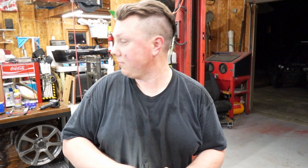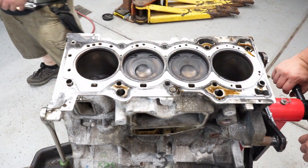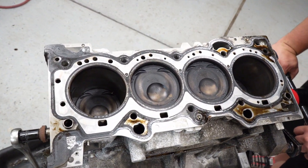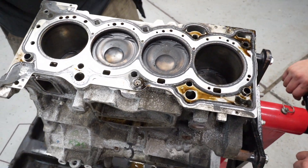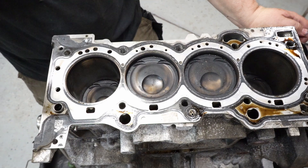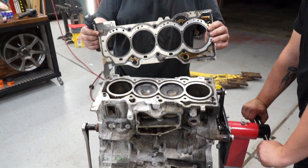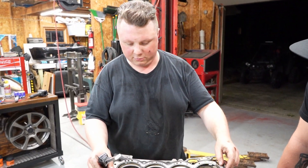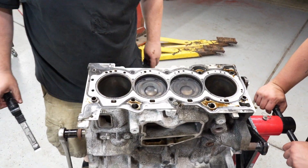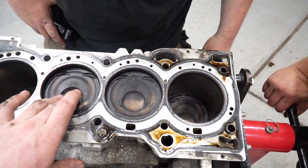That's the cool stuff you get knowing a Ford engineer or somebody who's got insider knowledge. He worked there — he's legit, he's a professional. So don't be scared of ever buying a Focus RS. Just make sure that if it's one of the earlier ones that it's had this done to it, or if you get to that point, do it yourself. It's not that hard. July 2017 is when the corrected head gasket was in production, so check your build dates. Other than that, this engine does not look that bad — somebody might actually be able to use this.